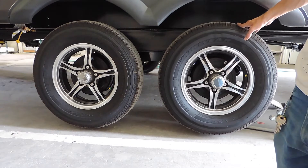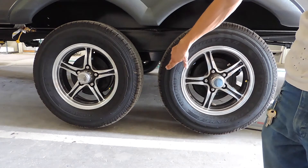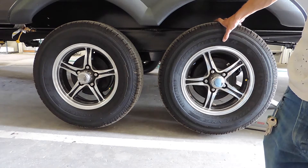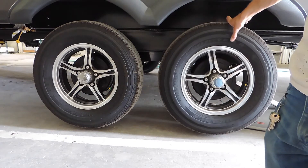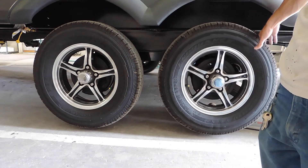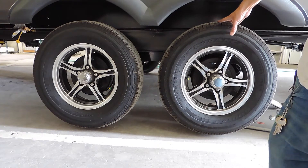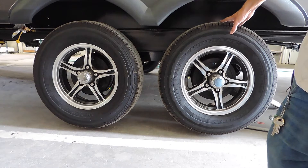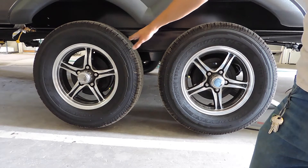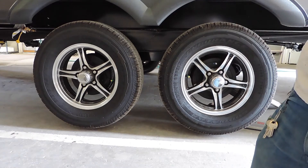These sensors — if you get a trailer that has a sensor already in the tire, the sensor should be opposite of the valve stem, all the way across. The reason I have the trailer jacked up right now is because you want these sensors in the tire to be as far away from each other as possible. Otherwise, the tire monitor can cross-code and you can lose codes as you put them in, which can become really frustrating. So if you can, jack the trailer up and put the valve stems as close together as possible so your sensors are as far apart as possible.